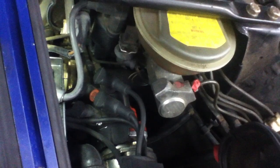This little guy that held that in. Well, I got the last screw out. Now hopefully I can maneuver this out of the way. Might have to pop off some of the wires. There ain't much room. There's actually no room. I was able to get the lower air box out and kind of see what's going on inside this distributor cap. This is just for 4 cylinders. Things are not good. It's just gonna need a new cap, but we'll sand her down for today. And the rotor itself, you know, she needs some sanding there too, you can see. Needs some sanding love.